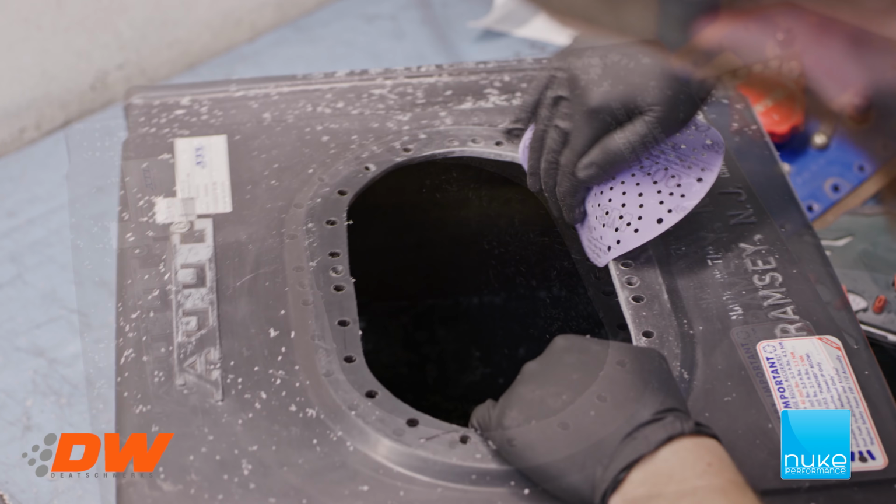So here we got the foam. So my idea is that we're going to put it in like this, and this will be the surge tank's part, and this will be the feeder pump. So we're going to remove this whole section, and this we will only remove a part so we can get the fuel pump into the bottom. So we're going to cut off the parts we don't need and make it fit.